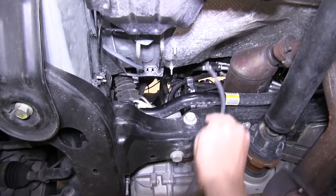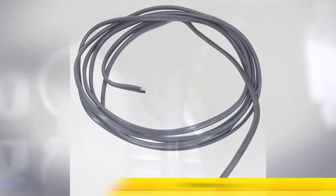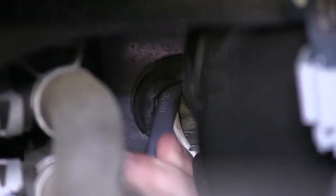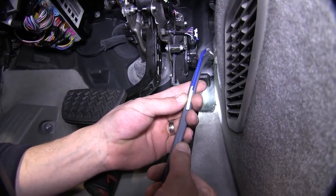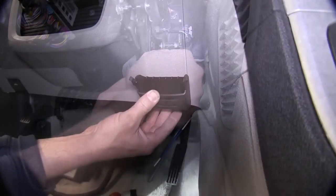For this application, we're going to add an additional ten-foot piece of the gray duplex cable. This will be necessary to run the power and ground for our brake controller. We'll take this additional piece and route it into the cabin of the vehicle following the white wire we previously ran. Now we can move inside the cabin and start mounting our brake controller and making our connections.